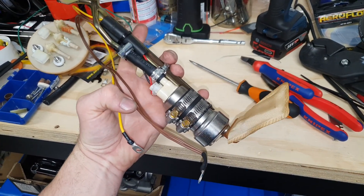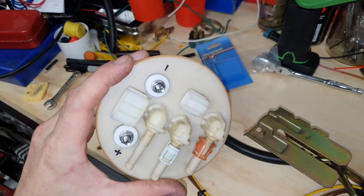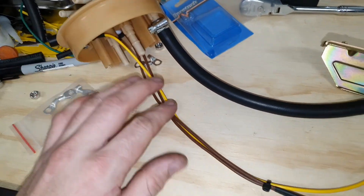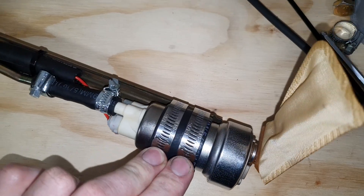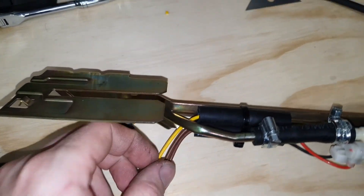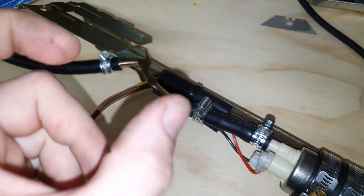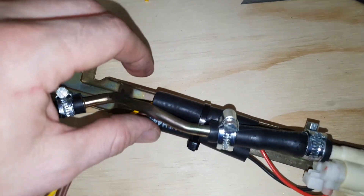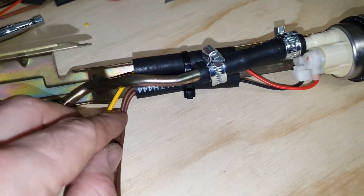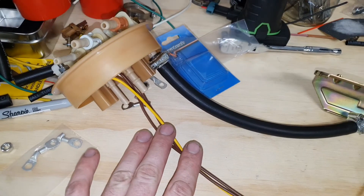A bit of overkill, but I just did not want this happening again. The fuel pump is ready to be mounted to the top hat. We've got 14 gauge wiring to the pump, fuel pump is nice and secure with two clamps. I've got two different lots of heat shrink - heat shrink on the actual crimp which I believe is okay for fuel - plus the fuel hose, so the wires run through two separate fuel hoses. There's no way it's going to short unless it rubs through somewhere else.